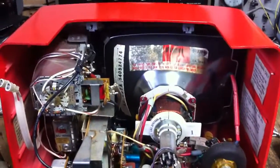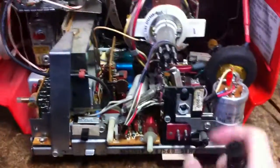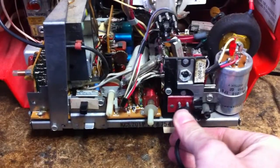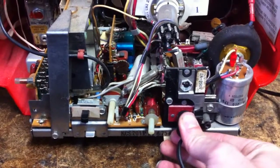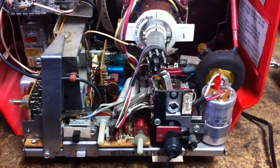Let's give this another shot here. Look how clean this is — this thing is like never used. No, I can definitely hear the high voltage there, crackling away. Probably from that exposed Ultor connection.